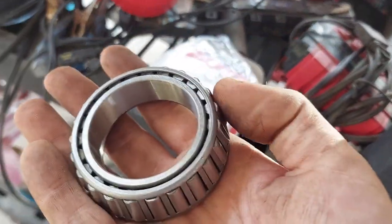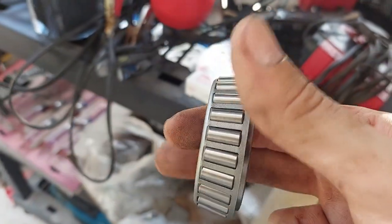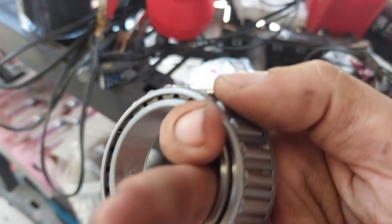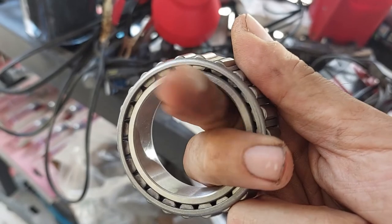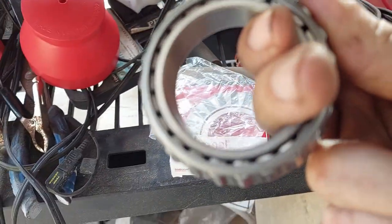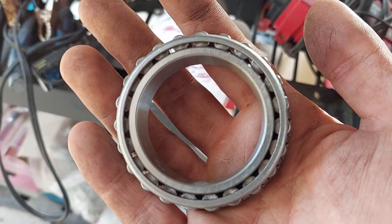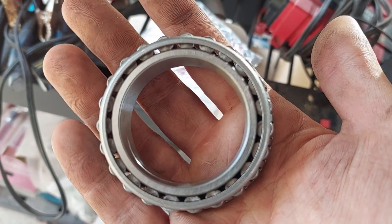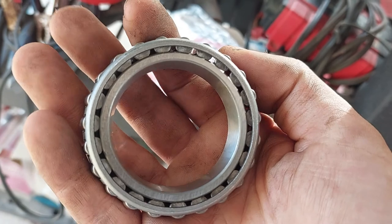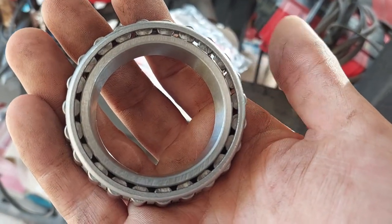You might be asking why it's so important that we get grease in these bearings. If you can see, there's a bunch of roller bearings in here, and it lets the wheel spin while sitting on the spindle so the spindle itself doesn't have to spin - that's how the wheels turn. Nothing in this world is perfect, so friction is made which makes heat. Unless you've got something to help lower the amount of friction, this metal will rapidly heat up enough that it will distemper. When it distempers it gets soft, and once it gets soft it begins to buckle and warp, and then it fails. Then your wheel locks up against your spindle at 60 miles an hour as you're going down the road, and it's not a pretty thing. That's why it's very important that you've got good grease fully inside all the little holes between the two rings of the bearing.